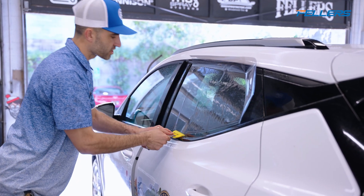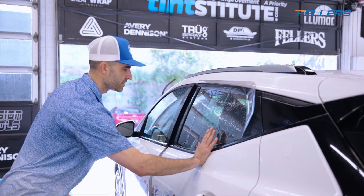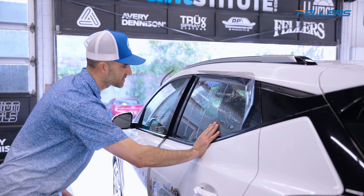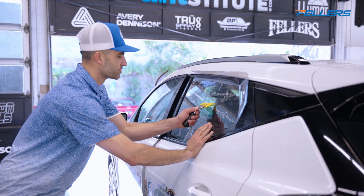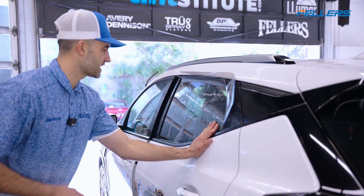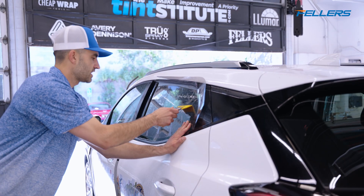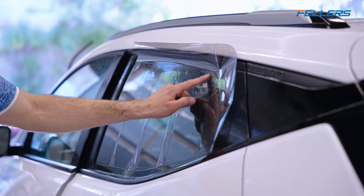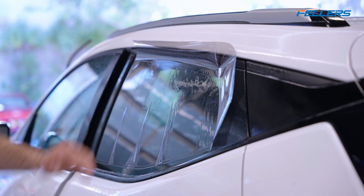Put my palm on the car, fingertips on the film, up and down until that finger breaks loose. Then I'll do another vertical swipe — put my hand on the car, up and down. You can see the finger breaking loose. Now that I've created those three fingers, you can see that the film is tight all along here and there's no fingers popping down.